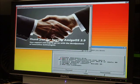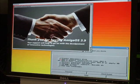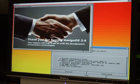Some of the other options are update over 3.5. I really don't like any of the update options. Honestly, I definitely recommend starting from a fresh hard drive, without a whole bunch of years' worth of accumulated crap on there. You would want to run this again to install the internet software, to install Genesis and AWeb. I don't even know what the CD-ROM driver does. You can see I didn't need to install anything special for my CD-ROM. This was the option to create the emergency disk that I used earlier, right there at the top. But we're going to do OS 3.9, full installation, proceed.